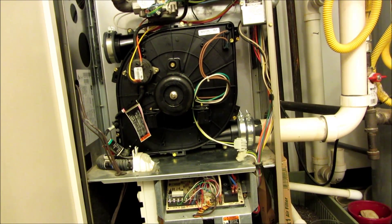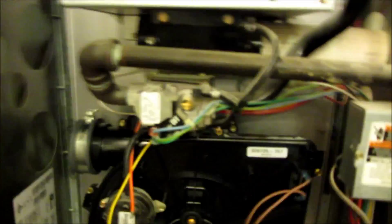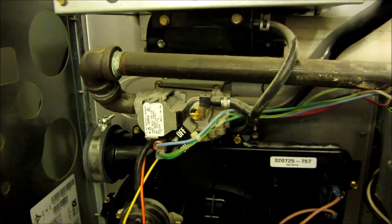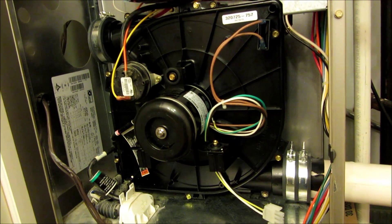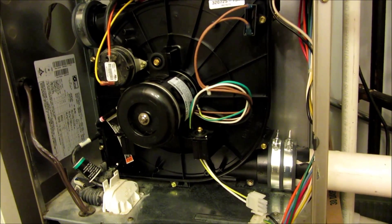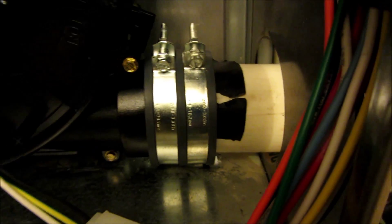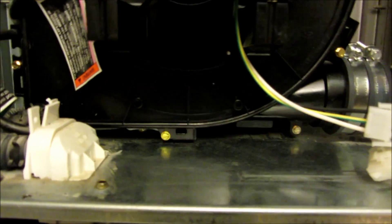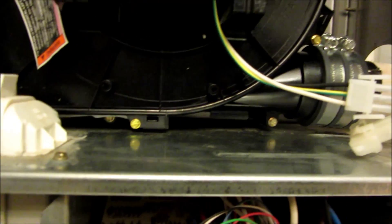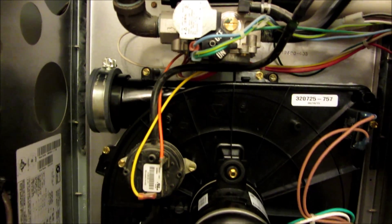And that's really it. You can see the electrical tape on the exhaust — it's very convenient to mark the exhaust so you know how deep you've put in the pipe. The last thing you need is to second-guess yourself whether you've pushed it in deep enough. Send me any questions you have, and I hope this helps. Thank you for watching.